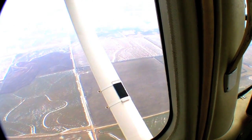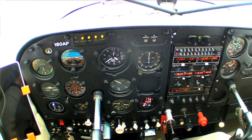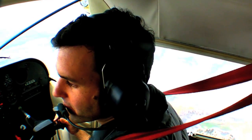Tell me about the fluid. The mixture is water and methanol — the ratio is 60% methanol, 39% water, and 1% oil. There's a little bit of oil to keep the rust away, since methanol is a little corrosive.